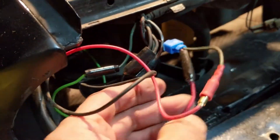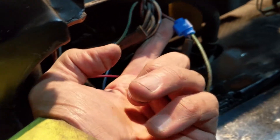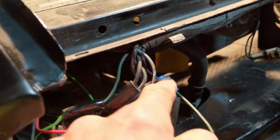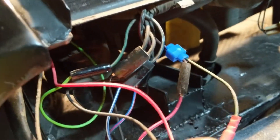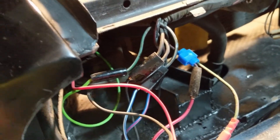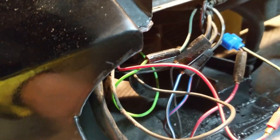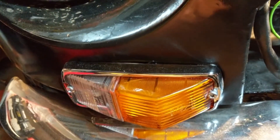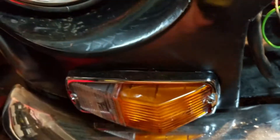I don't have any red wire, but what we've done at the front is taken the power lead coming from source and put one of these clips on, so we've just clipped it straight over the red with an extra connection, which we've then connected up. That gives us the side light, and then the green here gives us the flasher unit just here. So we've got side lights and flasher units both coming on.